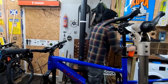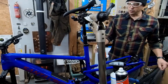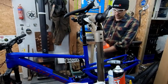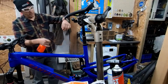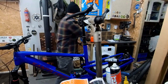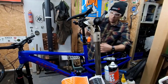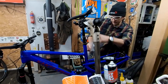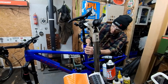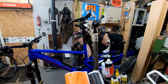Get your wetting solution and wet the bike down. This is the back of the seat tube. If it's not going to work well, make sure you've got your mister on and mist it out a little bit like this. Wet down your work area, wet your hands - you don't want greasy fingers. Before putting it on the frame, just check which way up it's going to go, align it with the center of the tube, and align it with the back of the seat post and pivots.